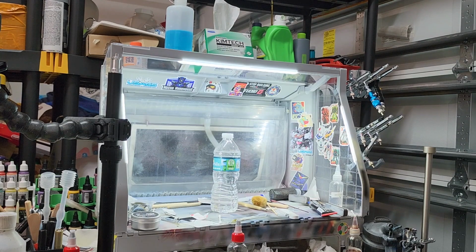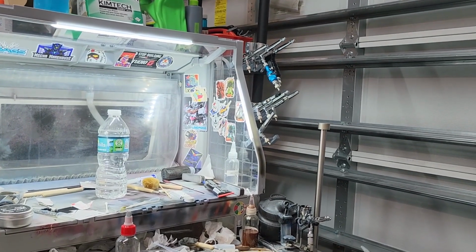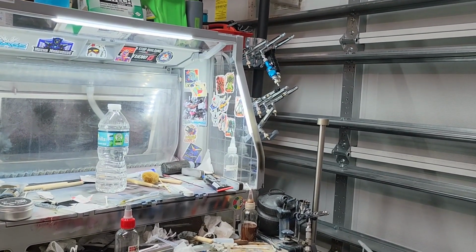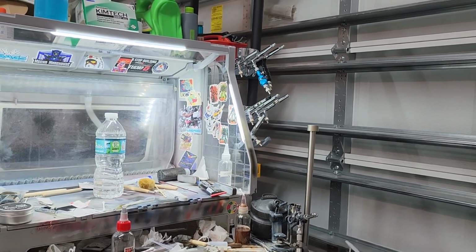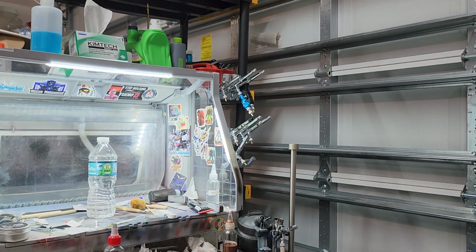It doesn't directly go in there, but if you look where I have my cup positioned, it is right next to that part, and the steam pretty much shoots out right there. So it is possible that even though that's filtered, the little pot shoots out solvent, especially cleaners. They may have had some effect on the immediate area right there that started to dissolve that plastic. But again, a little super glue, new O-rings, and things should work really well.